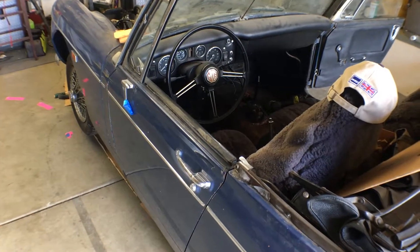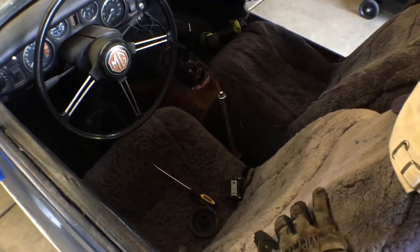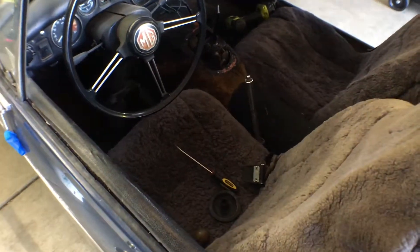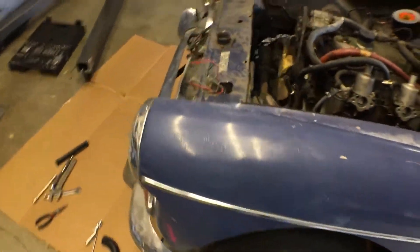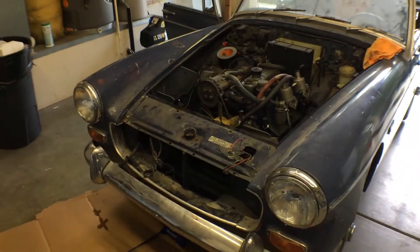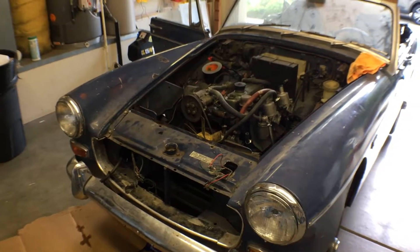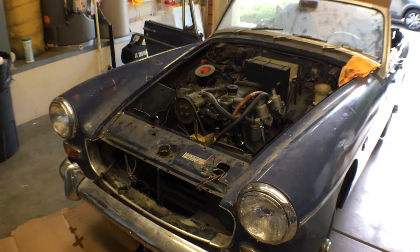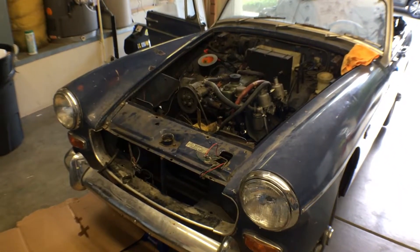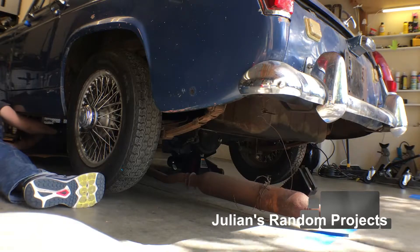It's going to be moving under its own power first, which would be kind of fun. Once it does, all of this is coming out — seats too. I'm not going to try and repair those unless the leather underneath is amazing and the covers are just there to protect, not cover up. My motivation for getting this thing yanked out now is that on Tuesday my electric motor, motor controller, and the rest of it all show up. I'd like to have the engine out so I can get started. I've got to make the adapter plate and the coupler between the electric motor and the transmission — a lot of things to do.